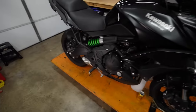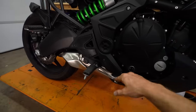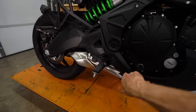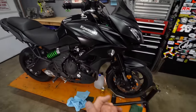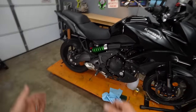Front brakes are done. For rear brakes, the procedure is exactly the same — except instead of pulling the lever, you're pushing on the pedal. You've got the bleeder valve on the rear caliper and the reservoir tucked up near the rear. Same process: keep an eye on the reservoir fluid, pump, open to bleed, close, and release. If you're wondering about ABS versus non-ABS bikes, there isn't much difference — ABS bikes just have more plumbing and more fluid to push out, so bleeding takes a bit longer. Thanks for watching and we'll see you next time.